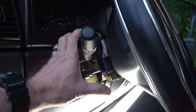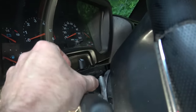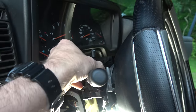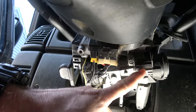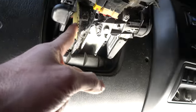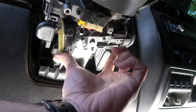So I pulled off the steering column cover — there are just a couple of standard Phillips head screws holding that in. Then I removed this, and I'll show you why here in a second. There are basically two T15 Torx screws that hold that on. You don't have to remove the whole thing — you just need to be able to lift it up to get to the ignition switch here. This is your cylinder for your lock where your key goes in. Your actuator pin for the ignition is underneath here, and then your actual ignition switch is underneath here. So the pin assembly is sandwiched in between these two, so we have to remove those to get to it. I went ahead and also bought a new replacement ignition switch since I've got to take it apart anyway — may as well just replace it, it was only like 17 bucks.